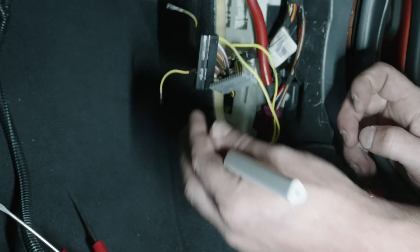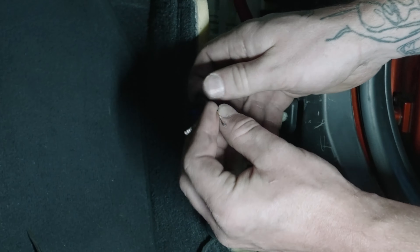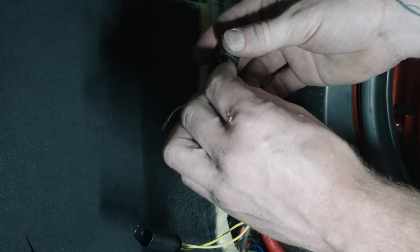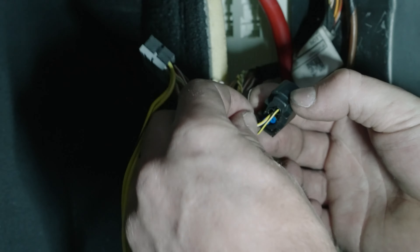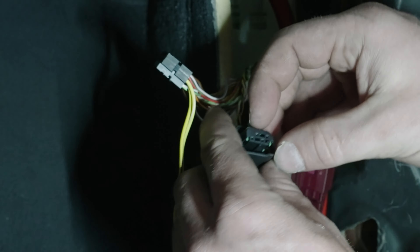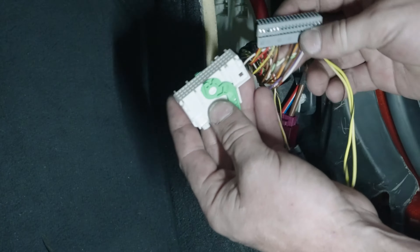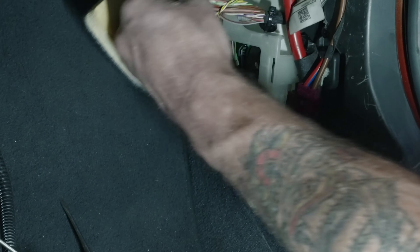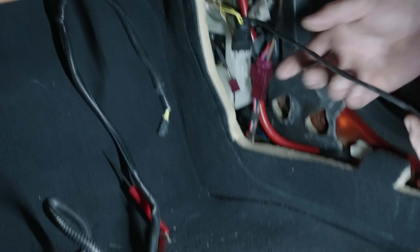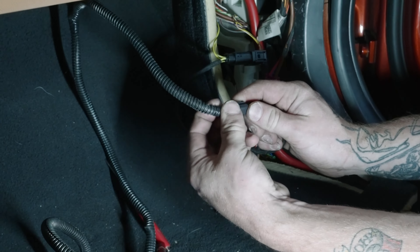Take these two that you separated and slide them back together. This clip connector also comes with the flex fuel kit — you're gonna pin the yellow and black wire into the lower one. The yellow and white goes into the other slot — both slightly click. Then push the green locking tab down, connect this into that, take your white casing again and slide that back over top. At this point, plug that back in, make sure it's nice and secure. This connector that we just plugged into the body control module just pops in right there — only fits one way.